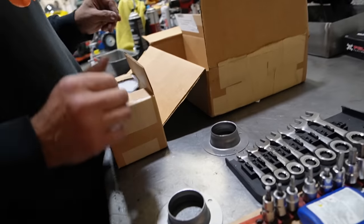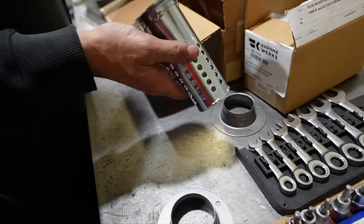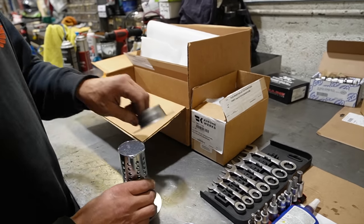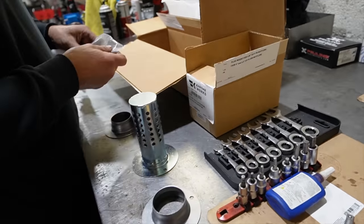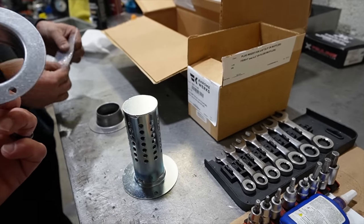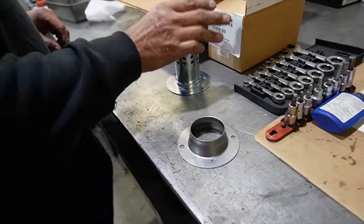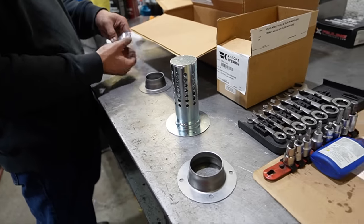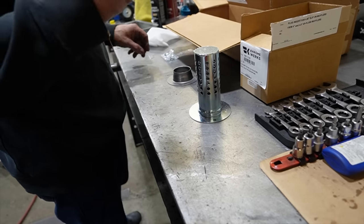Here's our choice: we have a reducer that helps build some torque, we have a metal earth style baffle which is actually similar to what I used to build, and these are some regular ones which I can cut up if I need to. Start with the smallest one — the reducer first. That's one baffle — it's actually a reducer to just give you a little more back pressure and keep a similar sound. I could always put it in later — it's almost like a DB killer, exactly. Let's put both of these in and see what it does.